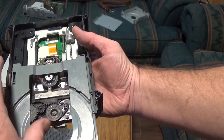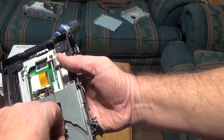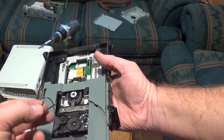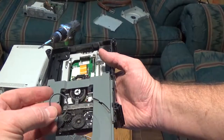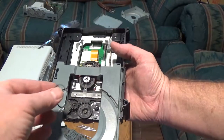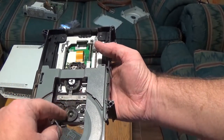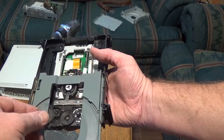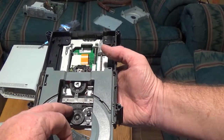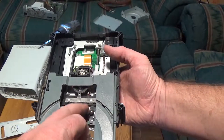All you're going to do now is once you get it open, just take this belt off. Then I'm going to clean this belt up - I'm just going to try using water and some Dawn dish soap. It's pretty gentle. Then maybe get a Q-tip and clean these grooves up. You don't want to put oil on there because it's slipping and that's kind of what's causing it.